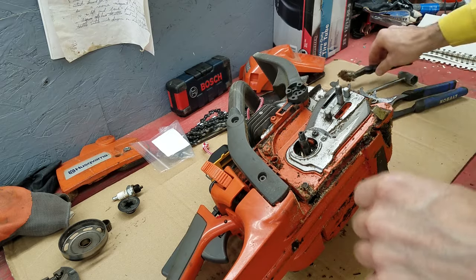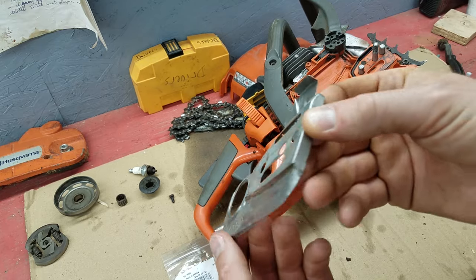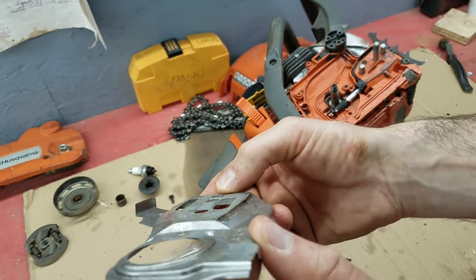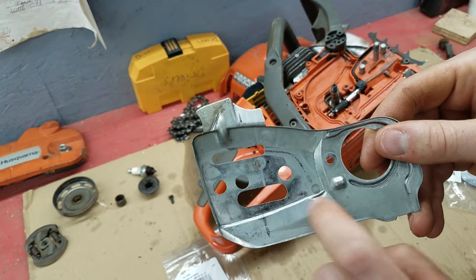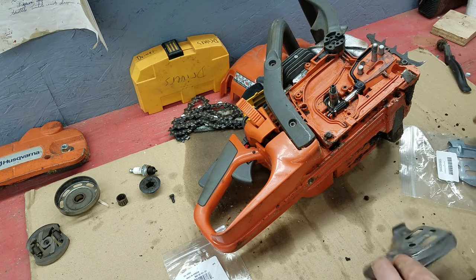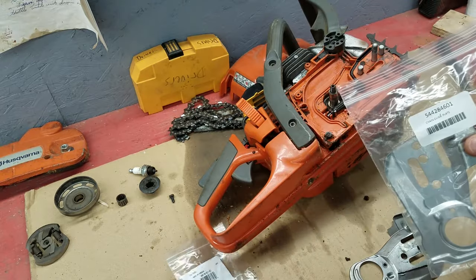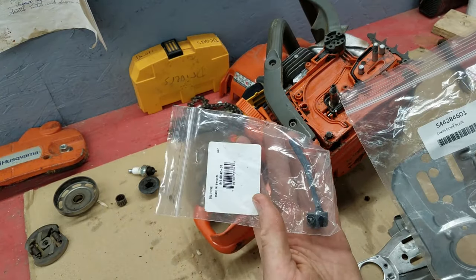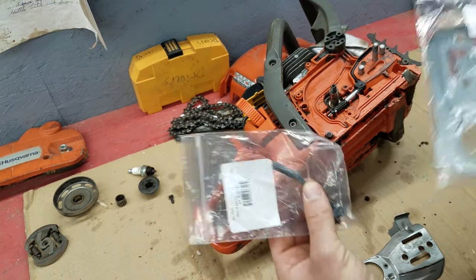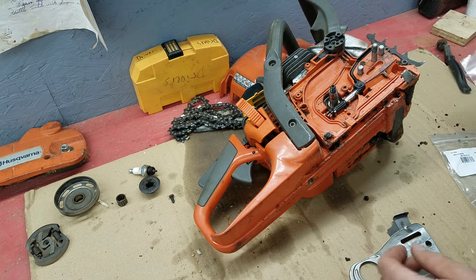You want to try and clean off as much of the gunk in there as you can. I took this plate off — you can probably see right there there's a groove that's cut down through it, and I think that's pushing in on this side, and that rests against the oil line. So I just ordered up a new one — it's called a chain guide plate. I have that and the oil hose. I got OEM just because this was like five bucks and this was fifteen; the Chinese knockoffs don't seem to last. So let's get these replaced.